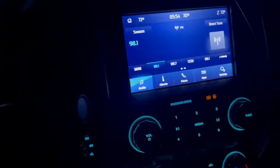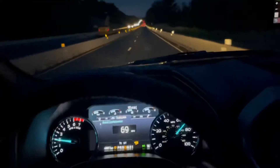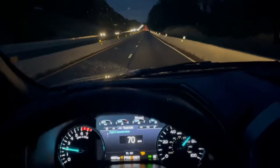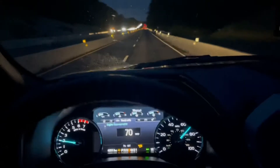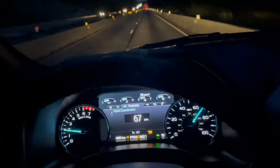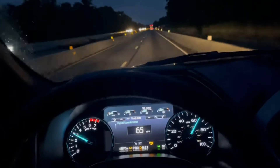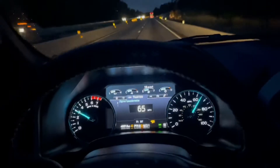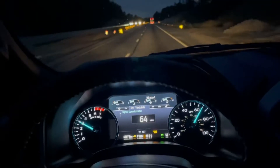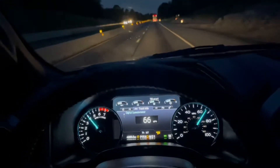Right now I'm running fully on natural gas because my tank pressure is at 500 PSI. Once it gets down to around 200 PSI, the truck will start blending — and you can't even tell the difference; you don't know what fuel you're running on. That button will always show you're on natural gas until the tank is completely empty. As for towing, I'm pulling that 10,000-pound trailer and it doesn't feel it — it's a 6.2 V8, very smooth. We're about to do a test going up and down hills right before South Carolina.